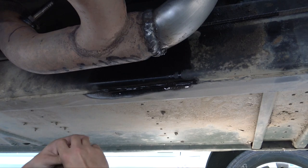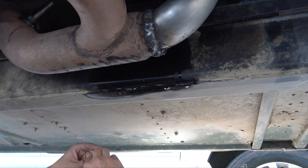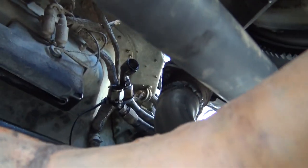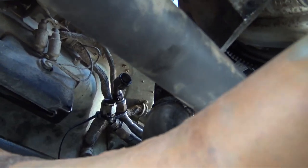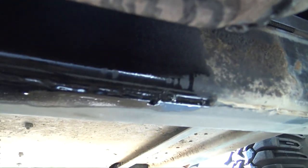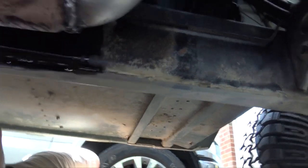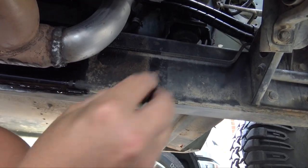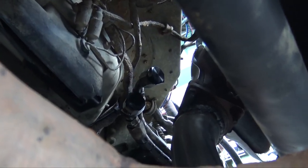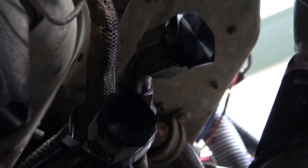Alright, so we're under the truck now staring at an oil leak. A lot of thoughts crossed my mind — did the driveshaft eat up the oil filter, is the oil pan leaking? But when you look a little closer, we didn't hook up the oil cooler lines. When we took a hard turn under power, the oil that was left in the oil cooler decided to dump all over my exhaust and frame. All I have to do is take these plugs — these are AN-10 — and plug up the holes. There we go. Got the AN plugs on them. Easy fix.